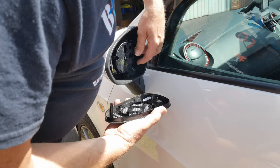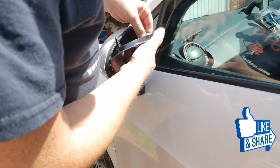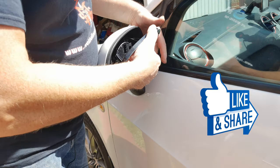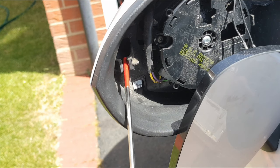To put the glass back in place, reconnect the heater terminals and make sure that they're properly home. Polarity doesn't matter, so it doesn't matter which wire goes to which terminal. This guide leg goes inside this clip here.